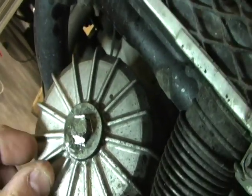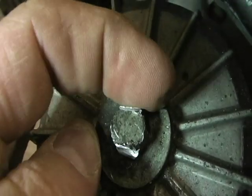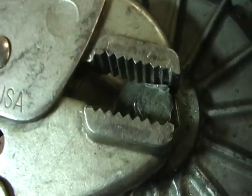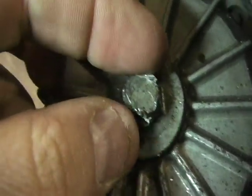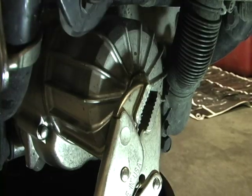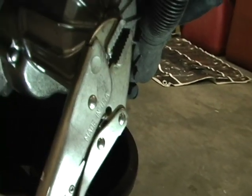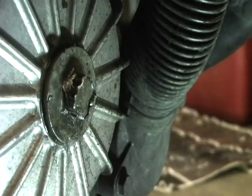I just got done grinding - I ground down this side and this other side here. I'm going to try and take the vise grips, get a really good grip on it, clamp down really hard, and pray that this thing will come loose. I don't know who tightened this, but the filter definitely needs to be changed. Well, not having much luck - this is absolutely insane. I have the vice grips on as tight as I can crank them and it's literally still chewing up the bolt.